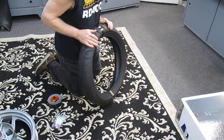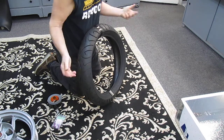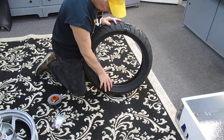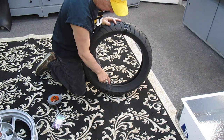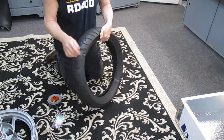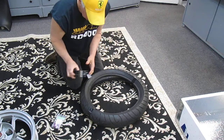I only need four — I found four pieces to be plenty. I tried doing eight and sixteen and whatever — unnecessary. When you take this tape off and it's not mounted to the rim yet, cut it or release it and make sure all the tape comes out, because if a little piece stays in there you wind up with an air leak and have to unseat the bead — just extra work.